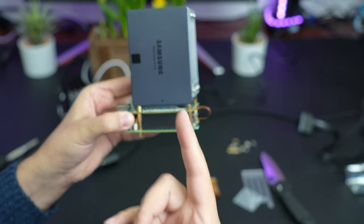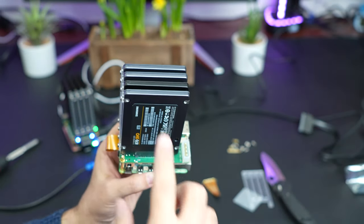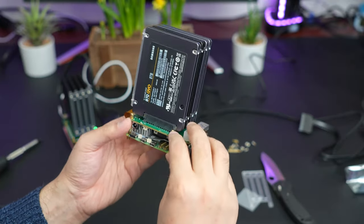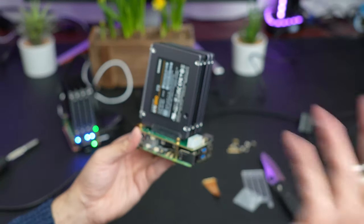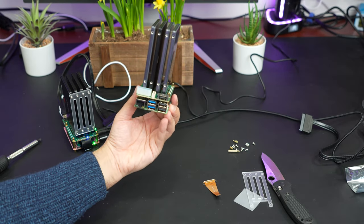It has the hard drives, a Raspberry Pi 5 with 8 GB memory, and a cooler. The best is actually to install a fan on top of this. I don't have one, but as I said, I'm doing this just for you guys. I'm not going to use this in the real world. If you're following this guide, I recommend you do the same thing and put a fan on here, or just keep it in a cool environment where the air flows. Here, when it's running, it's right in front of the air cooler, so there is a flow of chilly air.